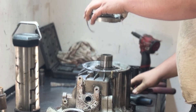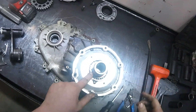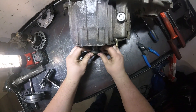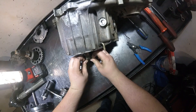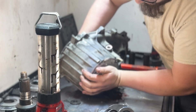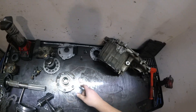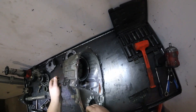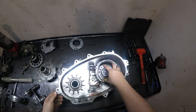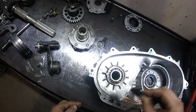Off that comes — that's our front output seal. Then we have a snap ring right here. Work that snap ring off, two taps, and out comes our six pinion planetary — just like that. We've got an empty case. I'm not going to bother pulling the ring gear out. Our case magnet fell out but it just slides into this half of the case.